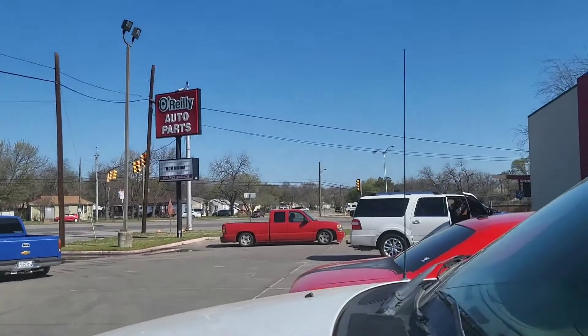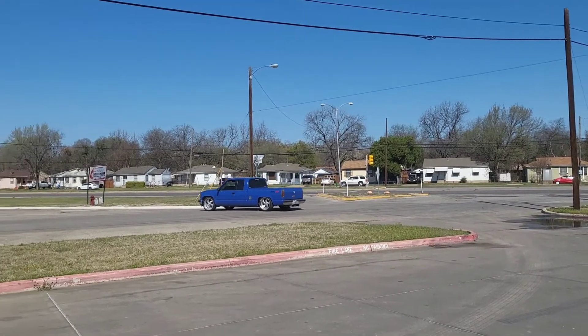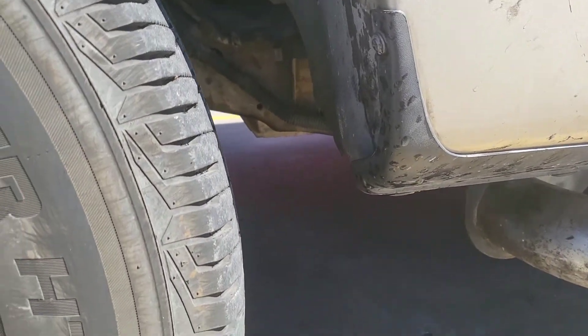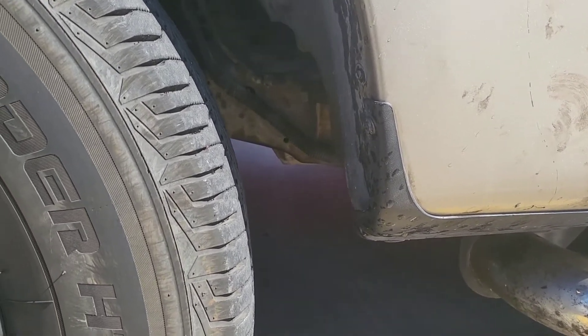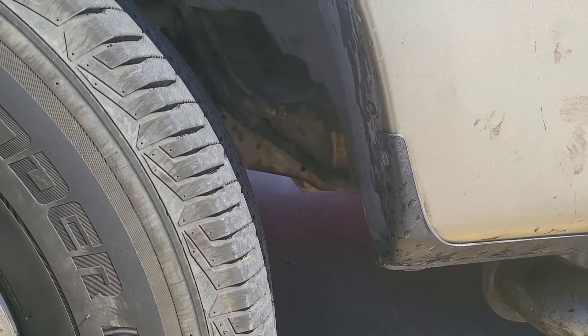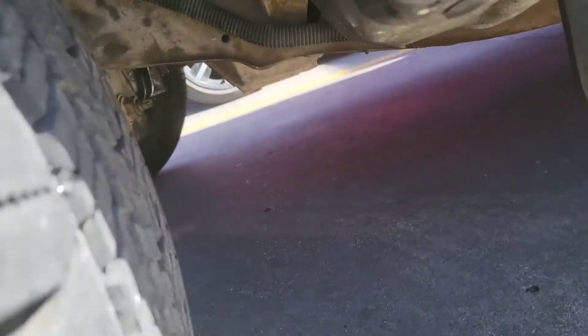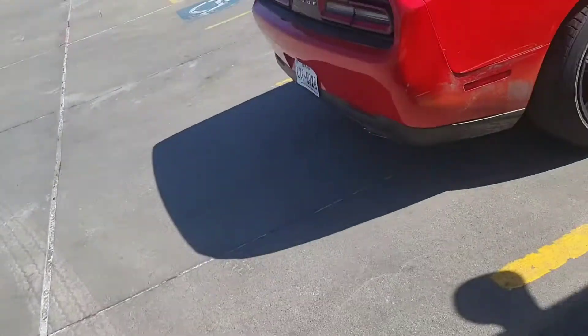All right guys, I think I fixed the leak. After you lift your motor — after you're doing transmission mount or motor mount work — there's sometimes a tendency that the cooler lines will come loose if you don't have thread locker on there. I had done a repair on my transmission so I thought I had cracked some line or something and was gonna go to the mechanic, but I decided not to. Crawl under your truck and get some goggles on because the hot fluid burns your eyes.